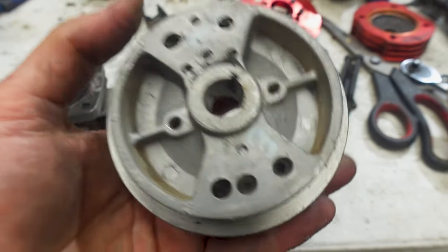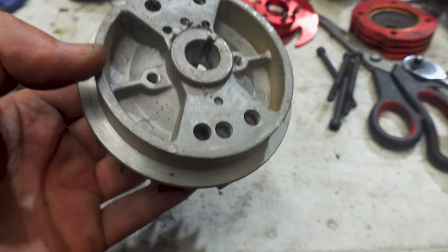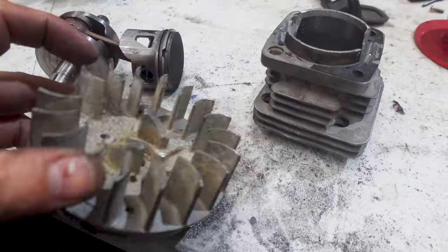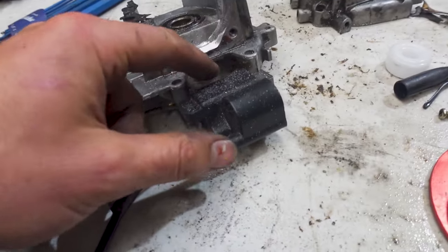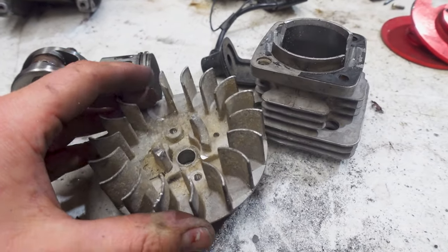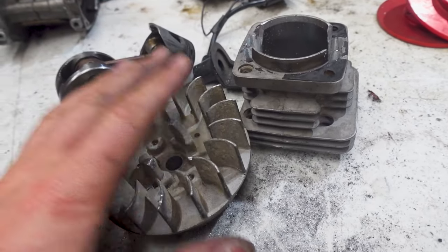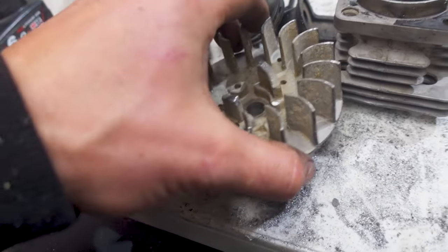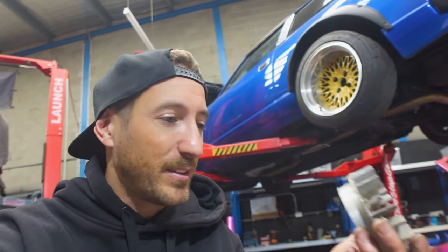The very last thing is to advance the timing a little bit. The flywheels have pieces of metal that fly past the magnet and coil — that's what triggers the spark. You can offset that to either advance or retard the timing. We're going to try advancing it by doing a little custom work within the flywheel to have it sit slightly advanced. We'll lighten the flywheel, then throw the motor back together. Let's go.